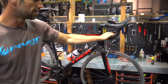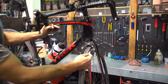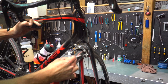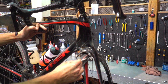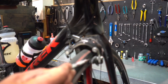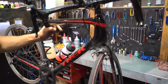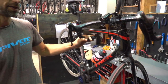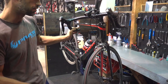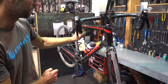Another key thing to keep your eye on is obviously brakes. Brake pads sit inside the caliper and there are wear lines on them — a line running down the length of the pad. When the pad wears down to that line, they are done and it's time to replace them. If you run them too far beyond that, you'll actually start to damage your rim. Before every few rides, maybe every couple of weeks, just take a quick look at your brake pads and make sure there's material left on there.